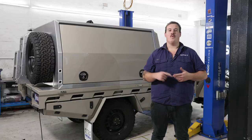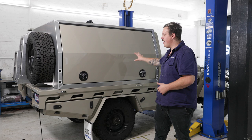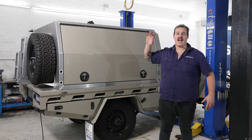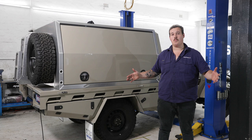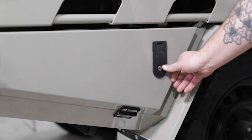If there's one thing Mitt's are consistently doing, it's absolutely nailing it when we send them work, and the FJ behind me is no different. It looks the part on the outside and works the part on the inside. Today we're going to be showing you the ins and outs of this tray canopy, including the 12-volt fit-out. It's now been painted body colour, which is a phenomenal match to the rest of the bodywork. The tray is about 2,100 long and around 1,800 wide, and the canopy itself is 1,800 long. In the otherwise dead space underneath a tray like this, we've put under-tray toolboxes — a really clever use of that area.